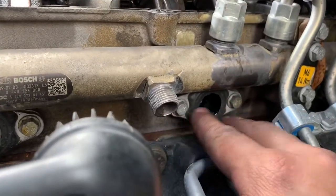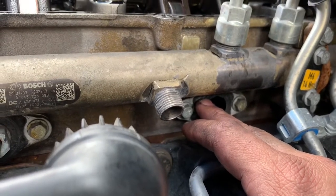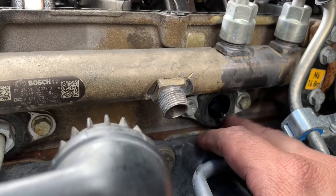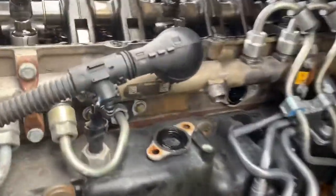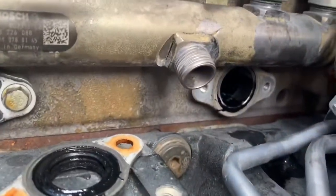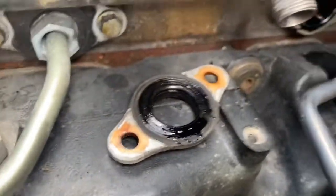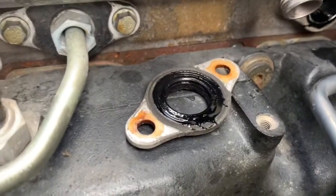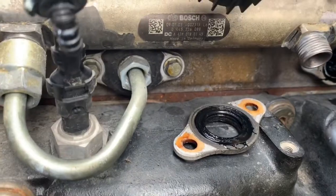The injector fuel line has been removed, as you can see. Now this is the seal. The new injector is going to come with the bolt — the hold-down bolt — and then the seal. Replace the seal using a 10 millimeter. Now that we have the seal removed, I just wanted to show you what it looks like without the seal. There's the cam housing, here's the seal. The new injector comes with the seal, so always replace it because this will tend to leak over time.